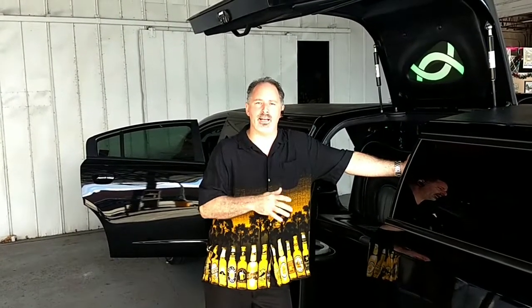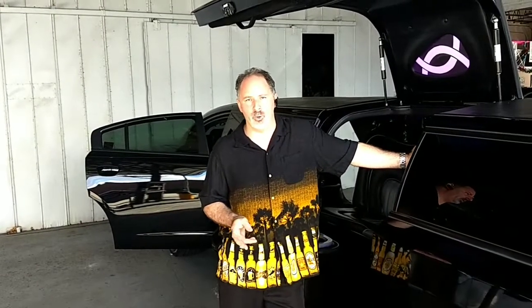A few key points to remember: the amount of Freon and oil you put in is very, very important. I was fortunate enough to get a hold of Frank at Pinnacle, and he was able to tell me how much Freon is supposed to go in this vehicle — about 3.12 pounds, and about 11 to 12 ounces of AC oil. There is a process if you're not able to get that information — I've done other videos on that. If you can't find the video that explains how to figure out how much Freon to put into a limo, just hit me up, send me a message, I'll explain it to you or give you a call.